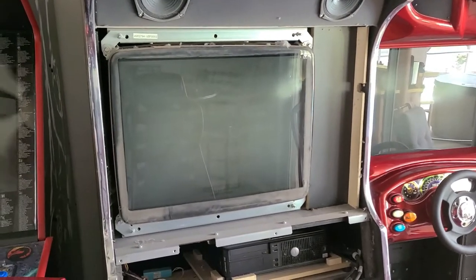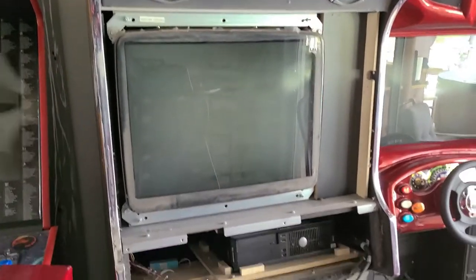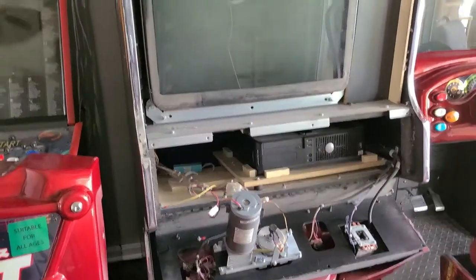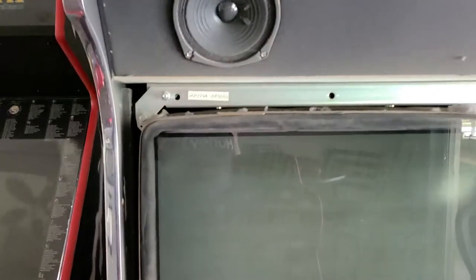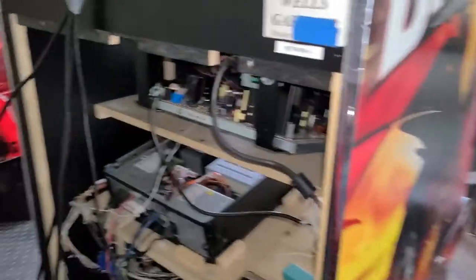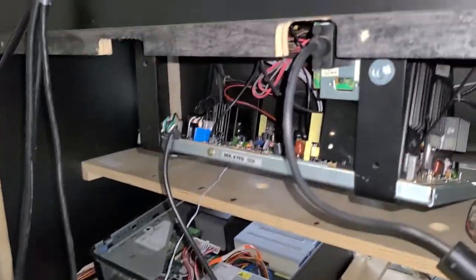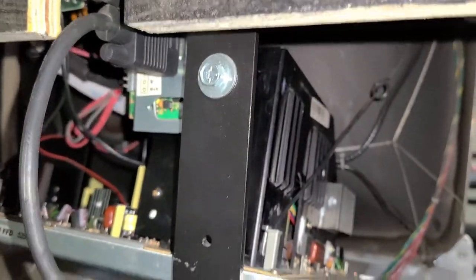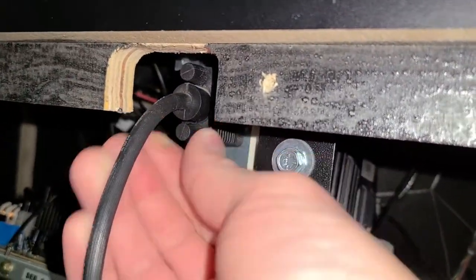Easy access at the back of this monitor. I think it's just got two plugs — one for the VGA and one for the power, and that is it. There is also a little monitor control pad attached to the chassis board. So we got the back of the machine off here. This is the rear chassis board on the monitor — all we're going to do is disconnect this VGA cable and this is your power cable, and that is literally it.